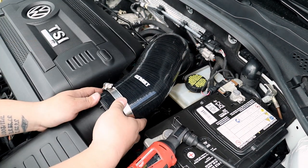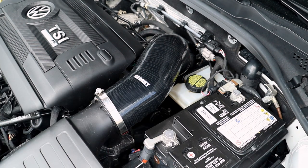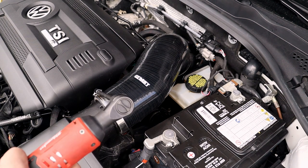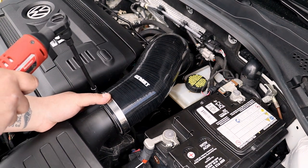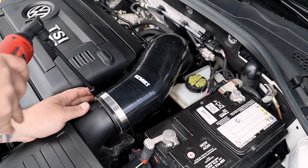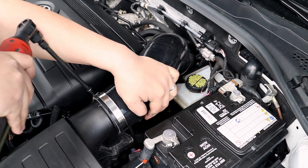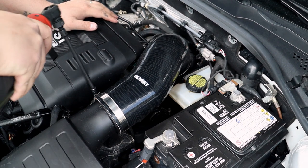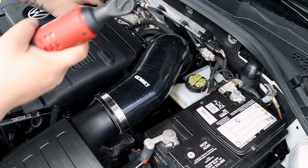Same thing for the intake box — I'm just doing my best to get the clamp and the hose sitting all the way so there's no gap. To tighten the hose clamp, you want it tight but not too tight where the plastic is going to break off — meaning the intake box — so just be careful with that part. For the rear clamp, I tried to use the Milwaukee electric ratchet but I didn't have enough space, so what I'm doing is just using my Stanley ratchet, which makes things a little bit easier.